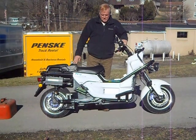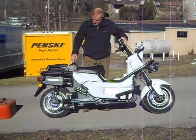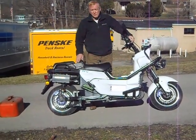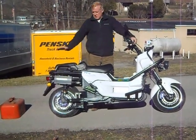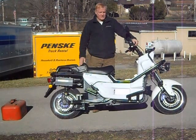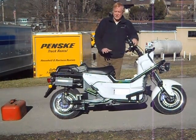For 2016, to try to exploit these tires a little better, we radically increased the size of the rear brake and we put dual very large front disc brakes on this bike. This also helps us if we're carrying heavy loads for commercial use, or if you have two people and you're in a mountain setting and you don't want to have any brake fade.